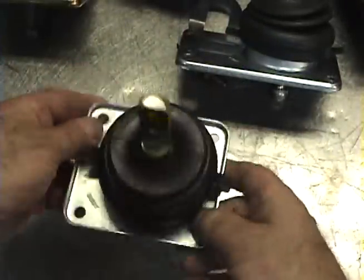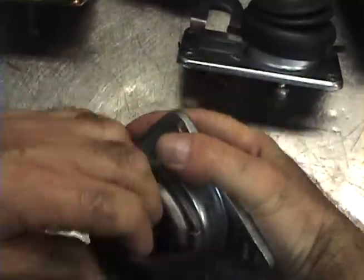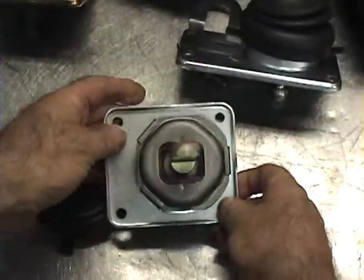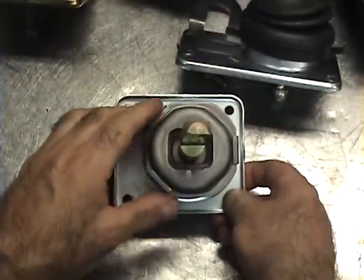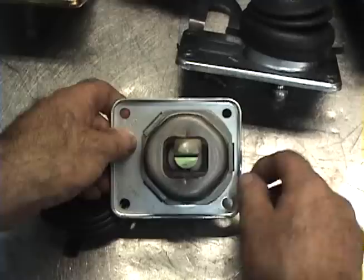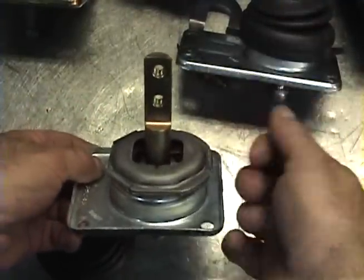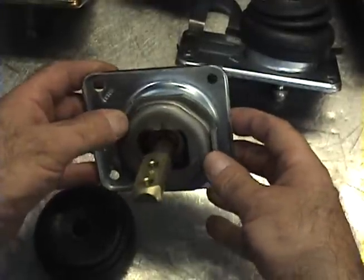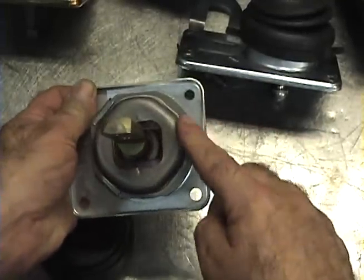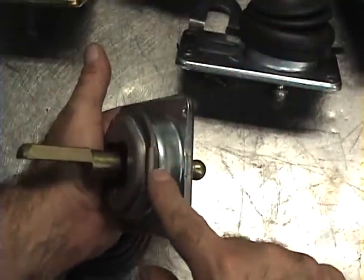This is your basic T5 shifter. We're going to take the boot off of it, and what you're going to see here are three little hold-downs for the front cover — two in the front and one in the back. A lot of people tend to peel these up, fold them over, do whatever they have to do, and knock them back down again. The problem is these usually crack — they're kind of hard. So it's easier just to cut this one off, slide everything out, put everything back, and then fuse weld along the side once it's together.